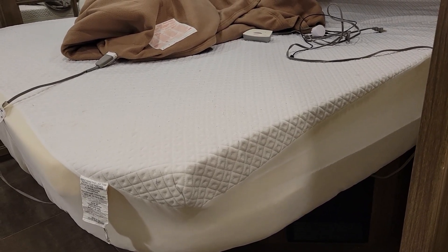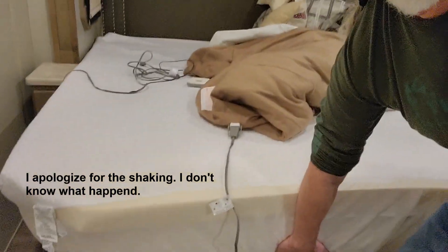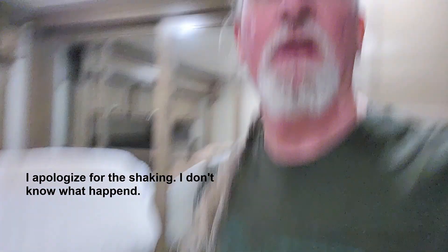It comes all the way back in without bumping or doing a hiccup, and solid as can be. So now we don't have to lift the bed anymore to raise it up. I'm going to call today's project a success. I can now grab the bed with one hand and lift it, and it stays up — all because of the hydraulic struts I put in — and the bed still slides in and out without the pedestal moving. Any questions, thoughts, or comments, please leave them below. Share it with your friends, and of course please subscribe. We'd like to get a few more subscribers. I hope you learned something and have wonderful camping trips. We'll talk to you all soon.